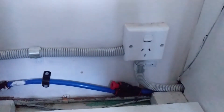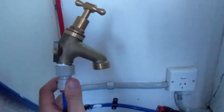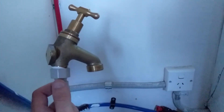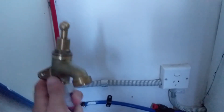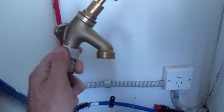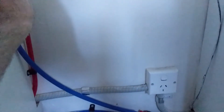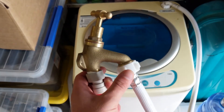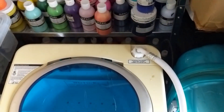We've got a PowerPoint installed where the washing machine will plug in, and a wire connector down below where it will also connect. We spoke to a caravan repair store about connecting the washing machine to John Guest fittings. They said all caravans have normal taps installed, so we're using a half inch BSP to John Guest adapter. The John Guest fitting comes up and screws onto the bottom of a tap, and then the washing machine inlet hose screws onto that, just like in a household.